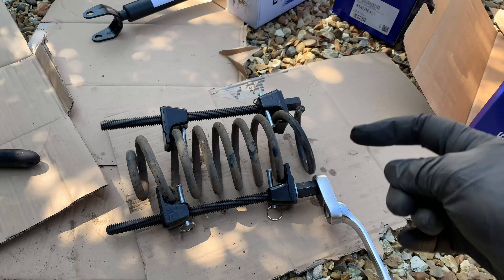This is day two. The other side is done and we're now going to do this side. I've definitely got to order a lower arm as the bushing at the bottom has definitely failed. I'm going to check this side because it might have been done previously - sometimes when it goes in for MOT and they find bushes that are failing, I just say get on with it while it's in there. I'm getting a bit old to be on my hands and knees for hours on end. Let's take the wheel off and see what this side's like.